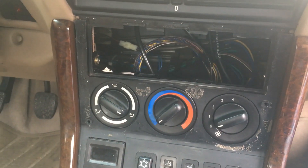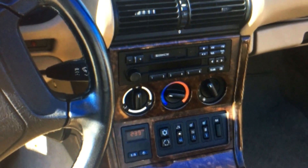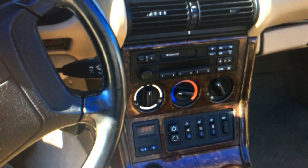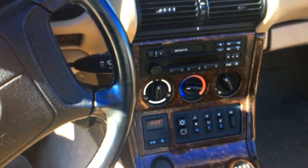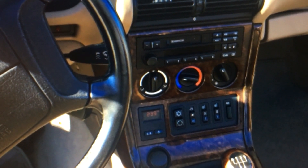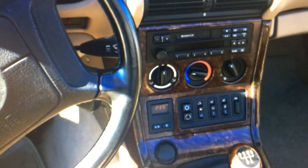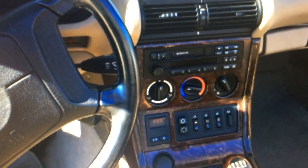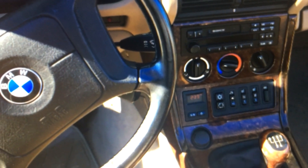I put it all back together and the heater control fan speed did not work any better — it was still either high or off. That ended up being a resistor under the hood that somebody else helped me with. The other thing wrong was the light bulbs in the old one weren't working, so now this one does work. Also, one of the gears controlling where the vent goes was off, and that's now working — but I didn't necessarily have to replace the unit; I just had to put the gear back on. The light bulbs are easy to replace too. So now I have the old one for sale on eBay since it's actually a working version. Thanks, guys — hope this helps.